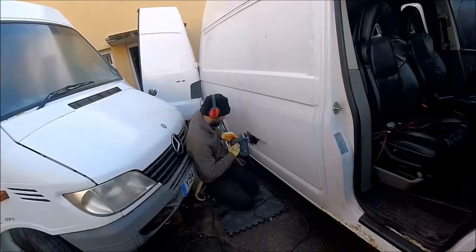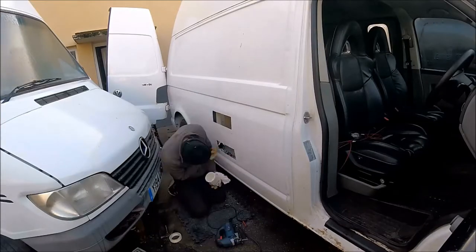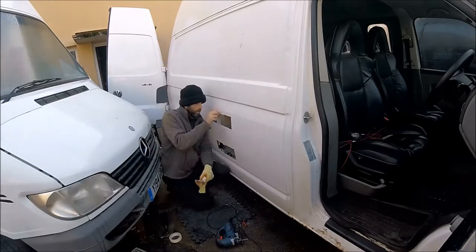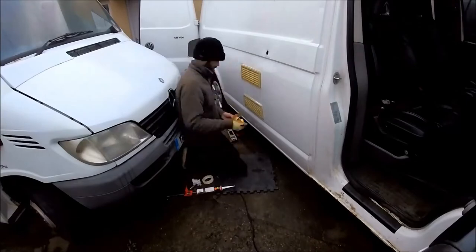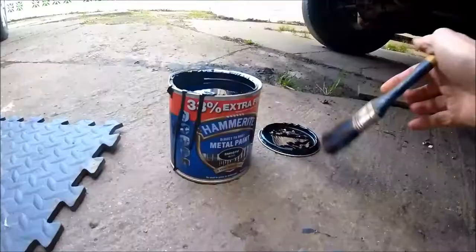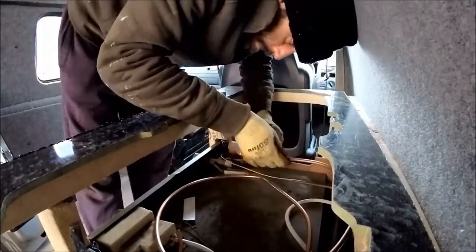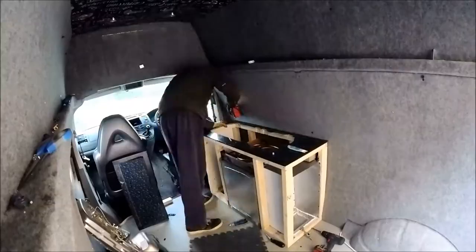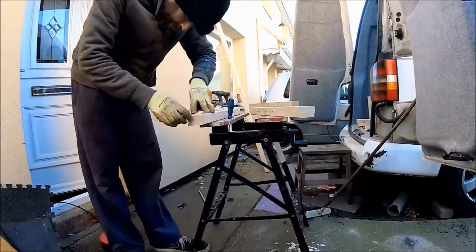Because a three-way fridge is being fitted, there are vent holes and an exhaust that need drilling and cutting into the panels of the van. Whenever holes are cut, they need painting and priming to ensure they won't rust in the future. The vents are then stuck on - the van is going to get a respray so all the vents will be repainted too. The gas storage area has a dropout hole, and again all holes are painted to protect the longevity of the van. The SMEV unit is relatively straightforward to fit - just a compression fitting straight onto the gas connection on the SMEV unit, connecting straight off to the gas supply.